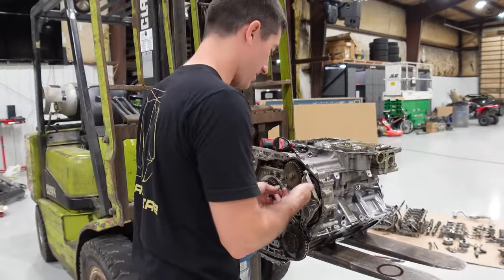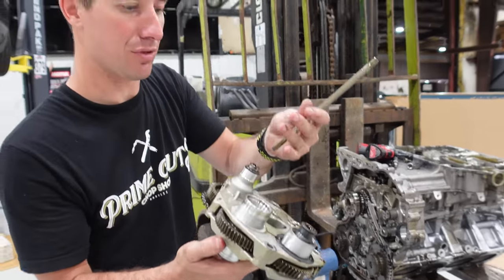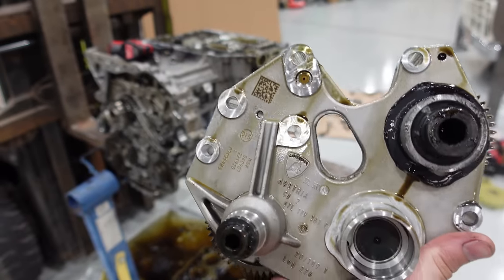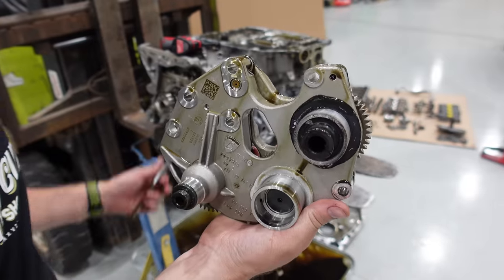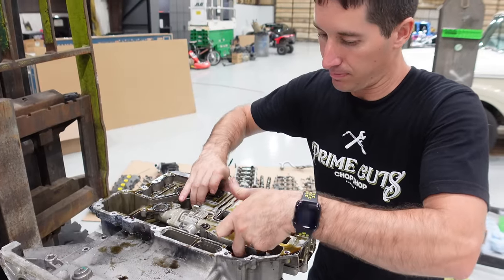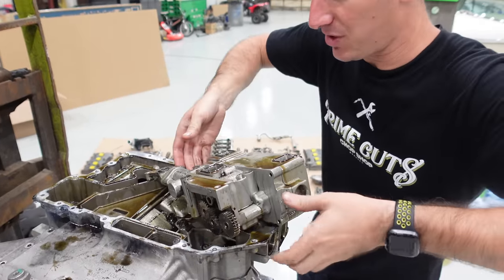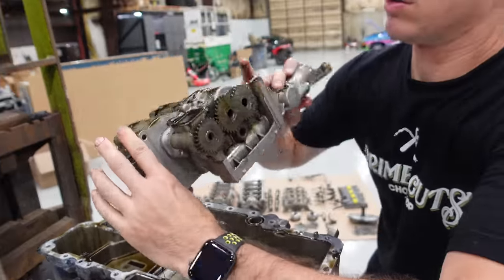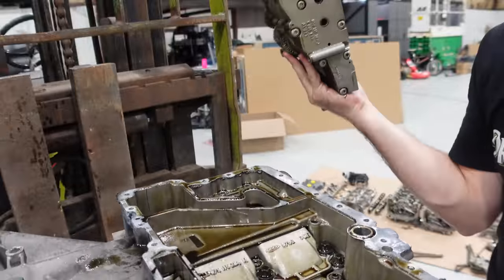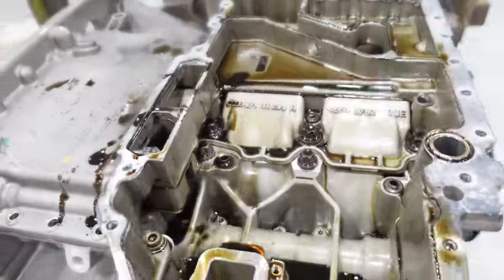Now that we've got it back together and had some fun running the thing, it should fall right out. Here's our oil pump drive shaft — we can pull the shaft now. Lamborghini — so many Lambo parts on this thing. Obviously everything on it is stamped with Lamborghini when it's coming apart, but this is the most Lamborghini-stamped one I've seen inside the engine. With the bolts out of the oil pump we can remove the oil pump. What a bunch of fancy parts in this engine. There's the gear drive, and you can see down inside all the oiling passages. Now we can start separating this lower pan from the upper pan.